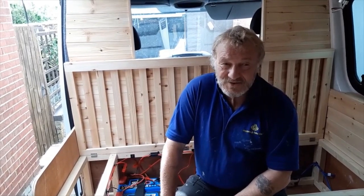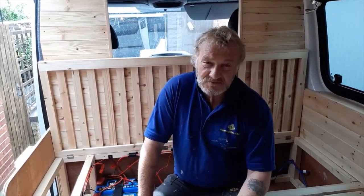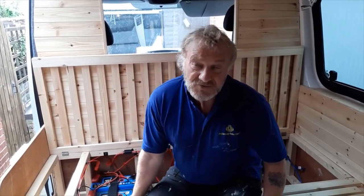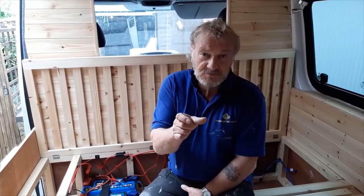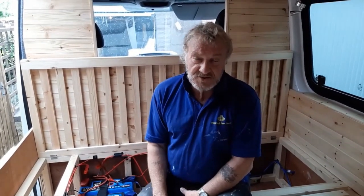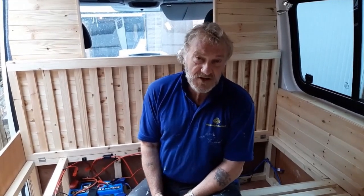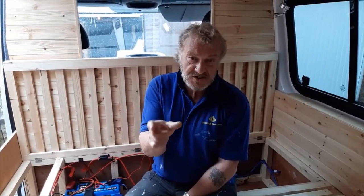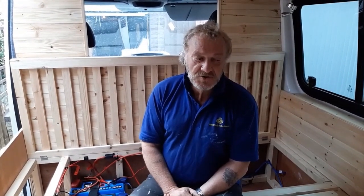I nipped down to see Darren at Skelton Autos — brilliant, looks after all my vans. I showed him the photograph of the battery where you could see the part number of the unit on the earth terminal. He phoned up the company he'd order the part from and asked whether it related to a smart alternator. They couldn't state it outright — it just said that particular part was a sensor. Based on that, Darren said you'd probably be better off, if you're in a position to do so, getting the more capable split charge relay.